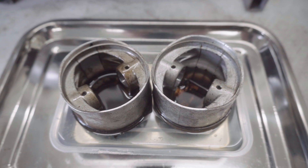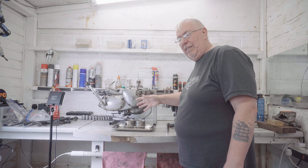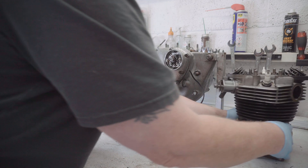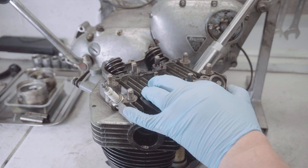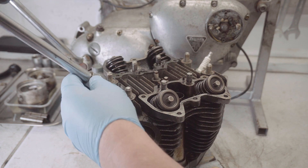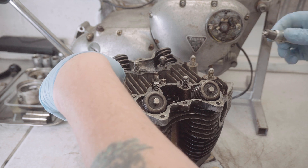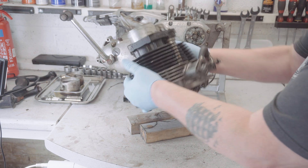While they're having a bath I'm going to measure the barrels. I've gone out of my way not to find out what the sizes should be, so I can measure them and then look at the standard — that way I get no target fixation of thinking they must be a particular size. I'll work these plugs out again before I turn it upside down. Luckily I've already given the bores a bit of a clean so I don't need to worry about that too much.